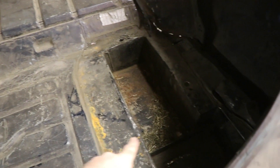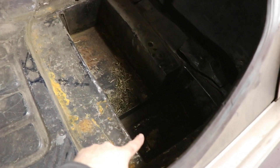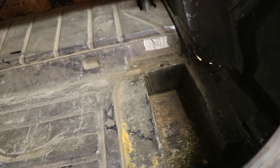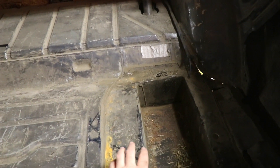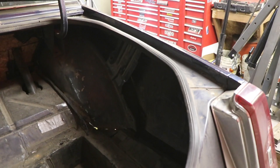It couldn't fit a full size spare tire in here anyway, and a couple years ago I had the battery mounted back here. My plan is to go with a lightweight battery up front, because otherwise you end up with like 12 pounds of wire running front to back, which is kind of silly. So I'm going to cut this out bigger and mount a full size spare tire in the trunk so I can actually close the deck lid.